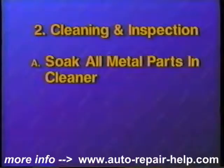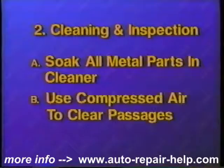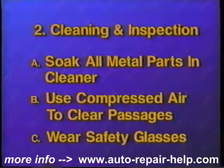Step 2, cleaning and inspection. Begin soaking all metal parts in a suitable carburetor cleaner solution. Do not, however, soak any electrical, vacuum, or plastic parts in the cleaner solution, as permanent damage will result. When removing the parts, be sure to get all the excess cleaner back into the container and blow out all air passages with compressed air. Remember to wear safety glasses whenever working with compressed air or aerosol sprays.